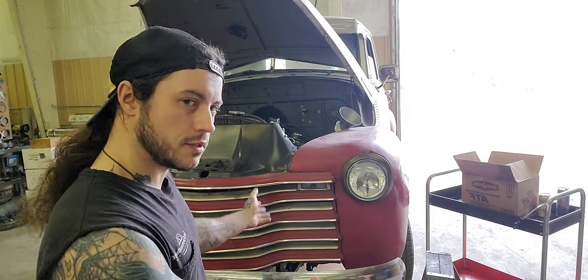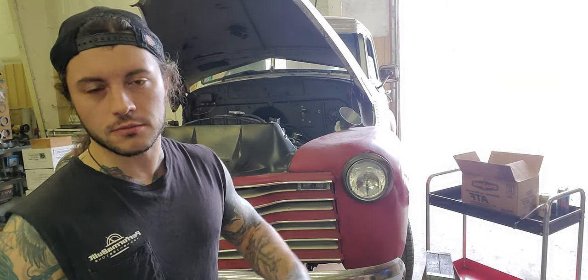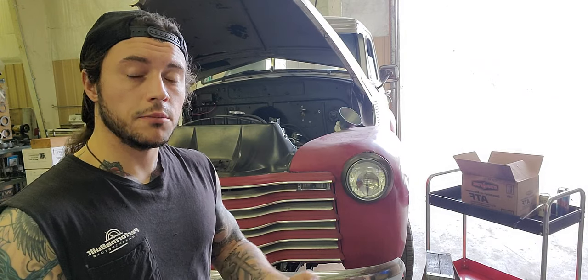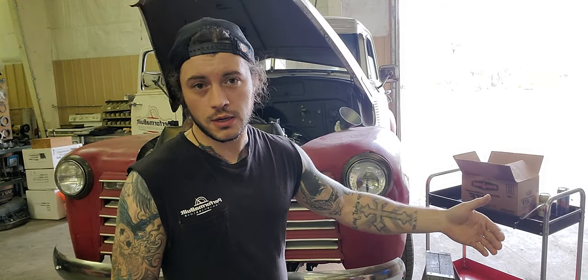So when you service this thing, do it after 1,000 miles to get all that clutch fuzz out of the system, which is stuff you can't really see, but it's so fine that it is stopping up your filter. There is no break-in. You don't have to drive it 5,000 miles nice and easy. That's totally made up throughout the industry, and it's complete bullshit. Okay, with a PerformaBuilt, you fill it up, you go do a burnout.